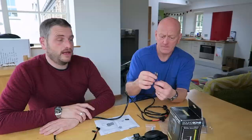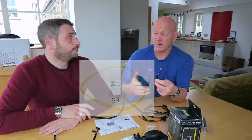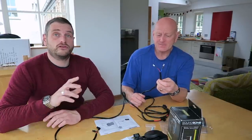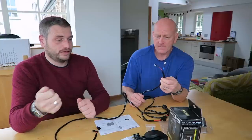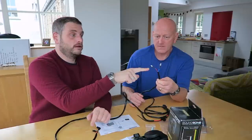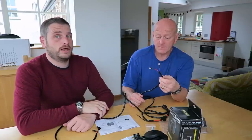We are on BMWs and they have the CAN bus system, which can be a total nightmare. We got the connections from Nippy Normans because they were the only people selling them at a reasonable price. They plug into the CAN bus, and on the end were just two wires, which we fitted with spade connections for our other horn. Those will just plug straight into these — it should be that simple.